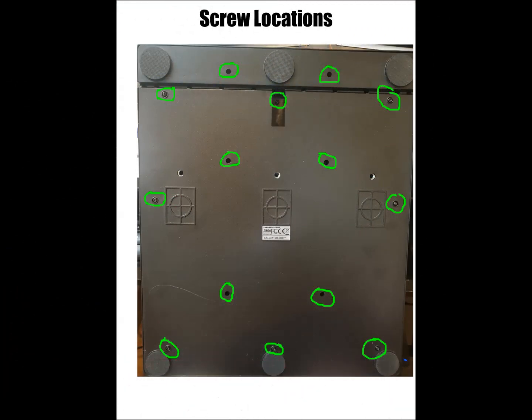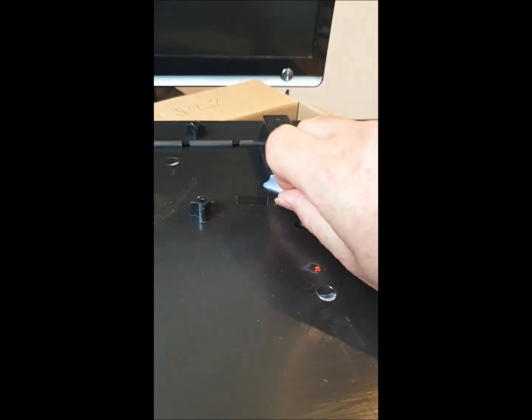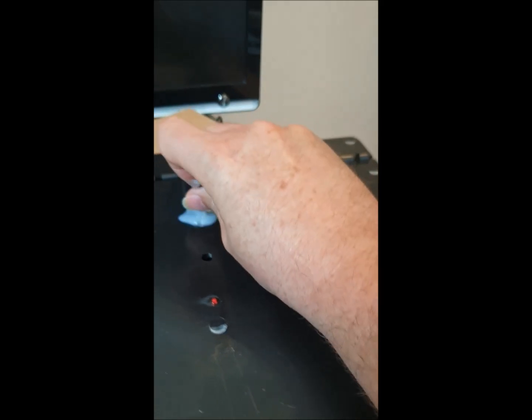The first step is to remove the base plate of the T3PA pedals. As you can see highlighted here are the 14 different screws that hold the plate on — I've highlighted them because some of them are not necessarily obvious. Undo all of those screws and release the plate. Once you've taken the plate off, unclip the plug and take out the cable completely, pulling it off through the little silicone they've used to hold it on.